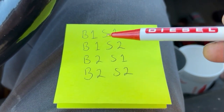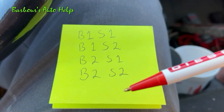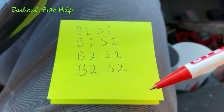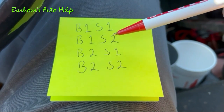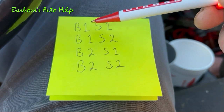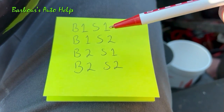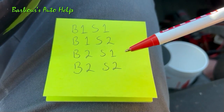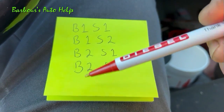If you're watching this video, you're probably familiar with these acronyms. They can be found at the end of diagnostic trouble codes related to oxygen sensor problems and they basically tell you where the oxygen sensor is located. This is bank 1 sensor 1, bank 1 sensor 2, bank 2 sensor 1, bank 2 sensor 2. The banks tell you what side of the engine you can find the oxygen sensor on, and sensor 1 or sensor 2 lets you know whether the oxygen sensor is upstream or downstream. We'll get into that later — for now, let's talk about banks.